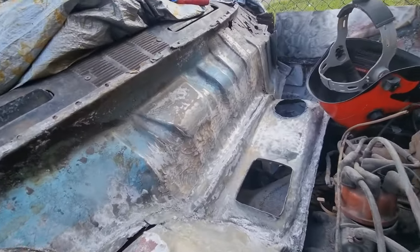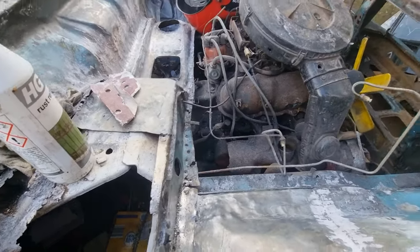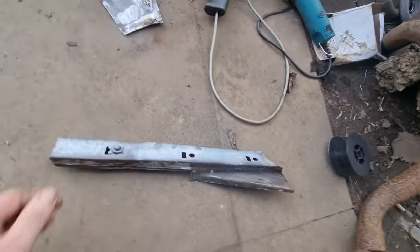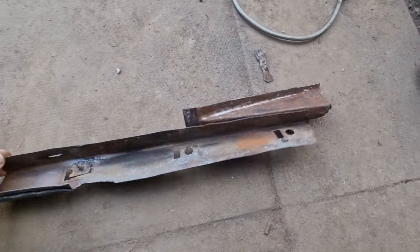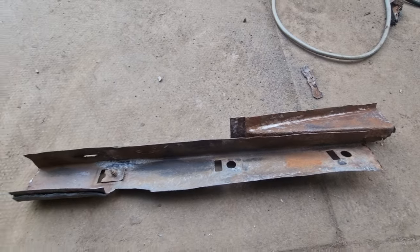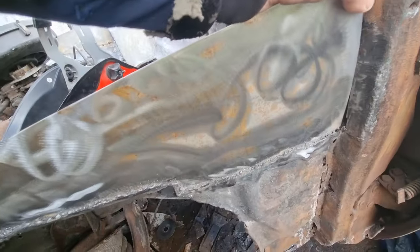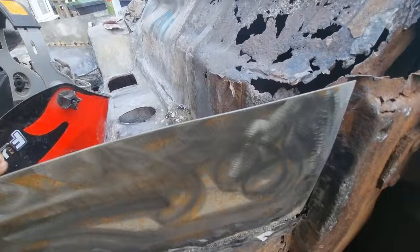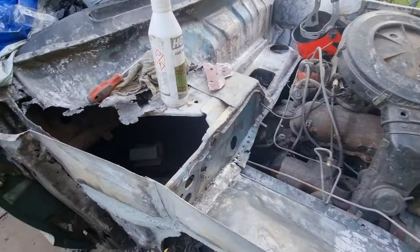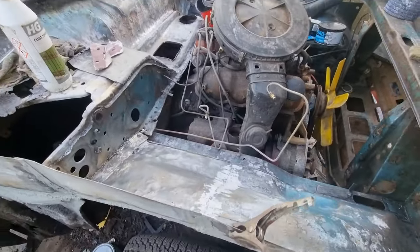I've been cleaning this up, got rid of all the filler, and decided to weld a bit more and put some fiberglass filler in there with the fiberglass matting. I've got this end piece. I just have to go back in on the passenger side, clean it up, put some rust treatment in and prime it before I put it back in because it'll be difficult to get to. I've got a few more bolts to do. I'm putting seam sealer on it — it's lined up in there ready for the lip to go in, same as the other side.